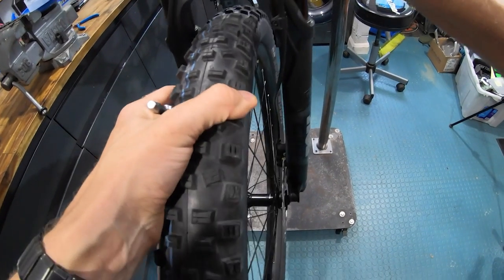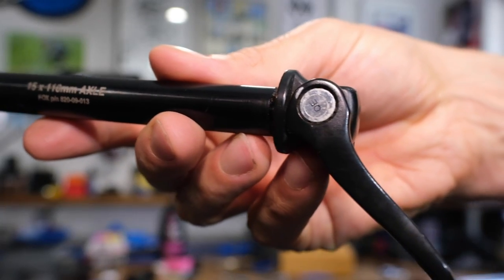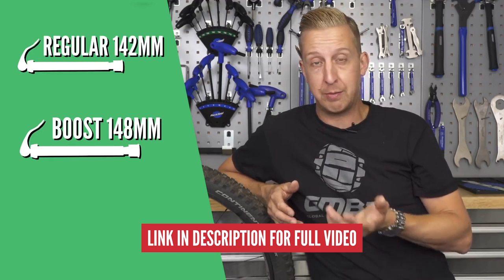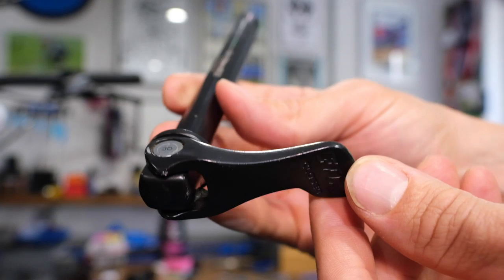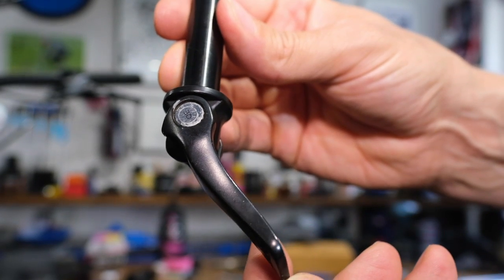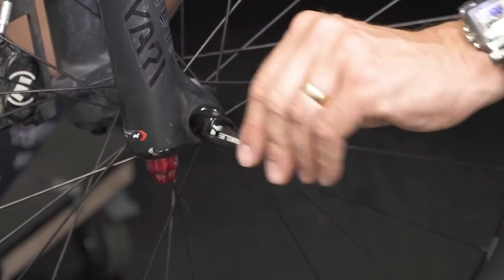Next up, it's time to get the wheel in. Your bike will either have an axle like this one, where you use a six millimeter Allen key to tighten it, or it may have a QR15 axle from a Fox fork — there are various different systems. If you're unsure, we've got a video in the description showing you exactly how to identify which one you have and how to put it in safely. With this lever type, you screw it in using the thread and use the lever to tighten it, then close the lever. Make sure you get the lever in the correct orientation — usually facing up. If it's facing forwards, you could accidentally open it by clipping a wall or shrubbery while riding, which could be dangerous.